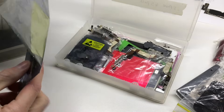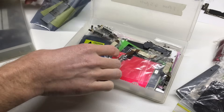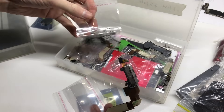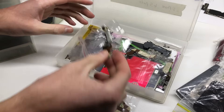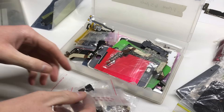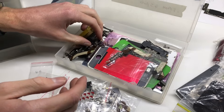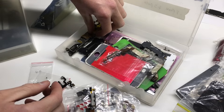You can see here we've got an iPhone 4 that says it works. We also have some 4S parts — looks to be a volume control for the 4S, and then heaps of dock connectors, all for the iPhone 4S. There are none for the iPhone 4. They do look slightly different — you can plug them into the iPhone 4 but the cabling sticks out the side, so you wouldn't be able to put the back cover on if you installed one in an iPhone 4.